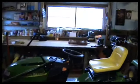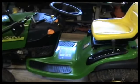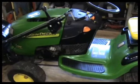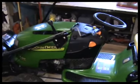Yesterday I was actually able to go out and finish cleaning up most of the leaves on the property, which is good because we got snow today. After I did that, I brought in my L-130 John Deere hydrostatic — my primary grass-cutting tractor. It has a 48-inch deck and a collection system that bags clippings, and it works really great for vacuuming up leaves. I took the deck and collecting system off, mounted the snow blower on the front, put chains on and weights in the back, so we're good to go.